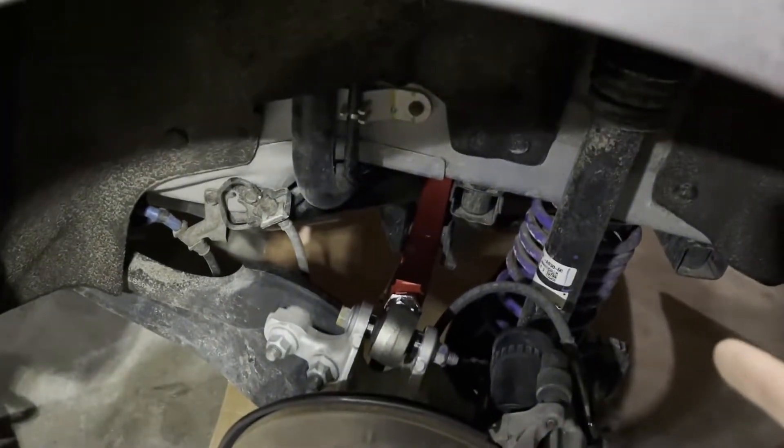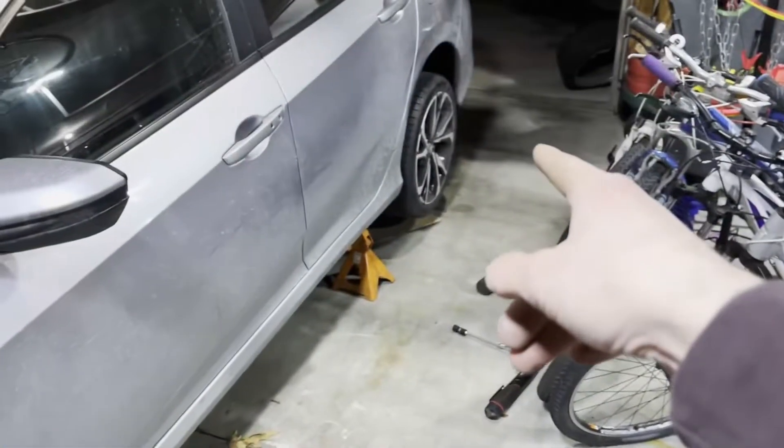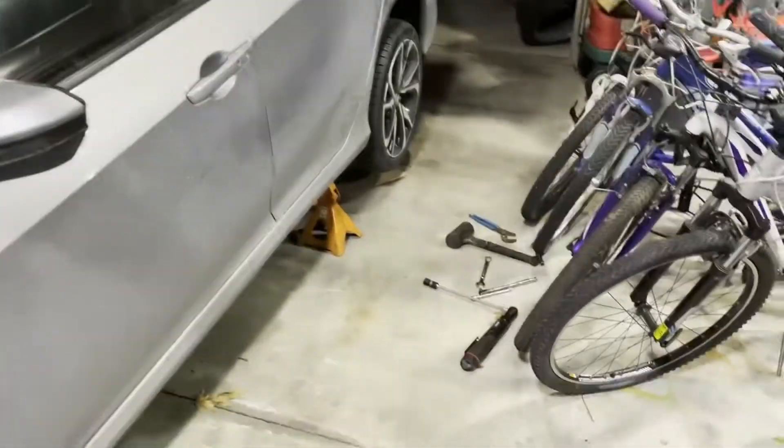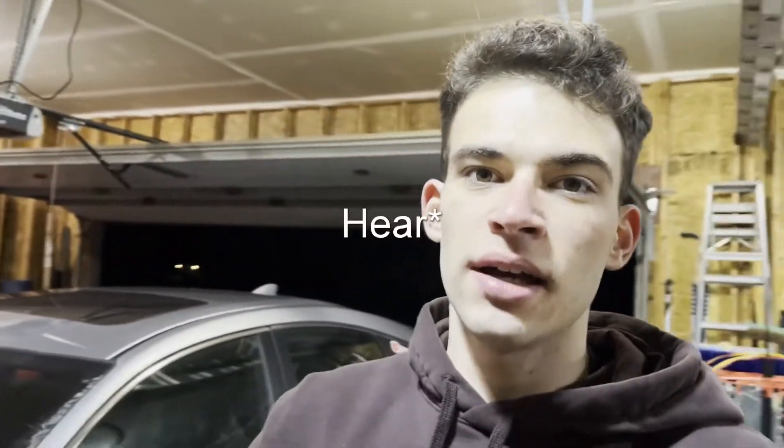I'm going to throw this wheel back on and then hit the other side. Hopefully with any luck I can get this done before the sun comes back out. So I got the second side out. As you can see, I already installed the one on that side, it's good to go. This side is an absolute bitch. This driver's side is impossible. You basically have to have a ratcheting 17mm wrench, and even then it is near impossible to get out. You have about that much room to get it. So no matter what you read online, listen to me: when you are doing this, be prepared. This will take a lot longer than you expect. If you think it's going to take three hours, double that and then add another hour. It is ridiculous, and I'm only done with one side. I still got to put that arm back in. So it's been a long day, but we're almost there. I'm excited. Finally have it in the car. Let's get to it.